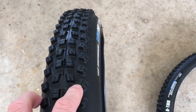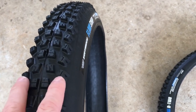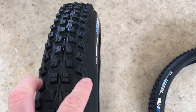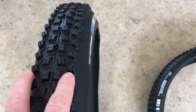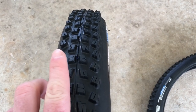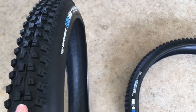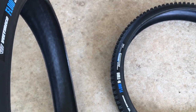Compounds: 48 on the side, give or take two, so around 48 — could be 46, could be 49, could be 50. You're hoping closer to 46 for those side knobs. And the tops around 52, same story, give or take two. Identical for front and rear — the Flow R2 is 48 and 52 as well.